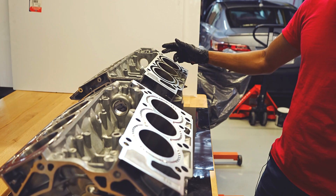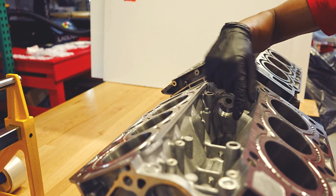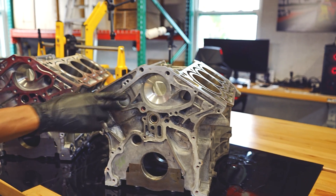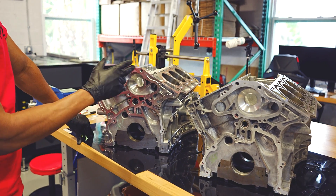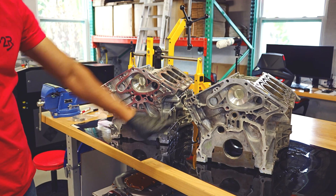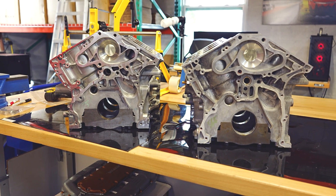The bore spacing is all the same. All the positions for the head studs and head bolts — all of that is the same. One thing I can see up here, which is similar to the Honda J35Y engines, is that it's using two knock sensors — one per bank — whereas the older engine only had one knock sensor shared for the whole engine. Looking at the water pump area and oil pump area on both blocks, they look very similar. Honda definitely kept it very similar, so I'd bet retrofitting a lot of these things is not going to be that complicated to do.